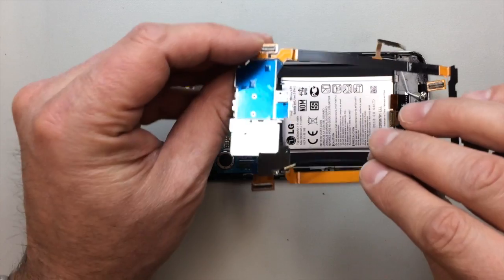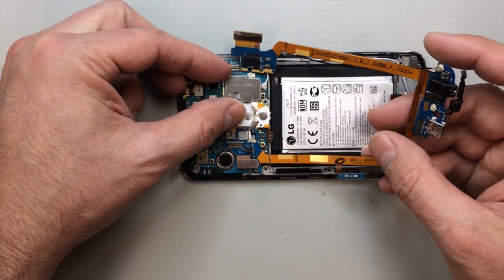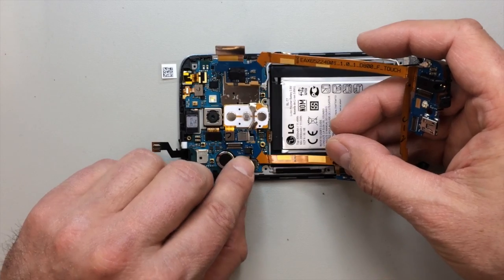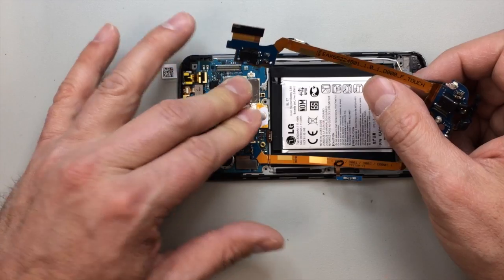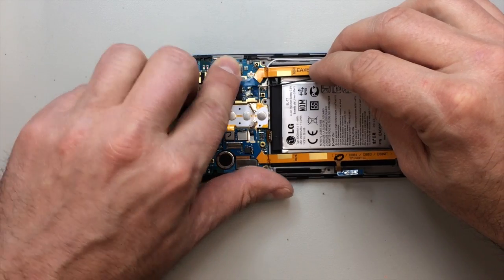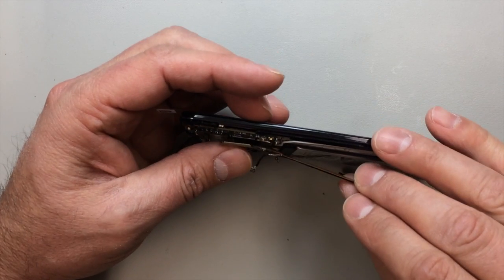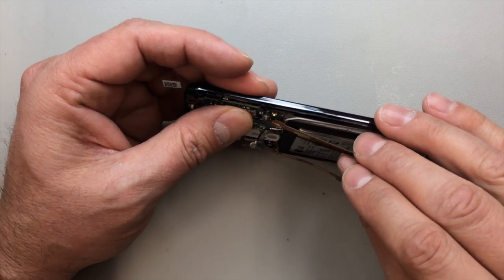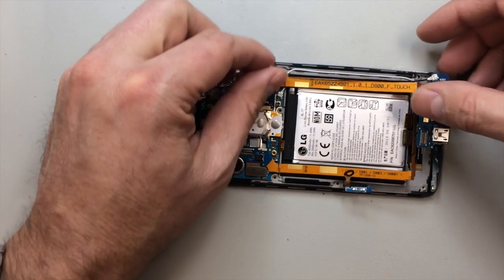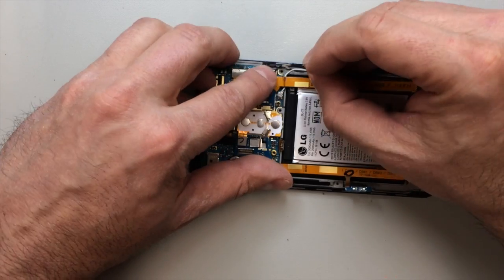I was looking at why the connector won't go into the board — that's because there's another piece that needs to go in first. The pop connector for the digitizer at the top is actually built into the secondary piece that has the power button on it, so we'll go ahead and install this first. Aligning these pop connectors can be a bit tricky — make sure not to force them if they're not straight. Excessive pressure can actually damage them, and in the worst case scenario if you damage the connector on the logic board you're probably going to have to start all over and find a replacement unit.